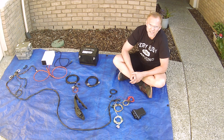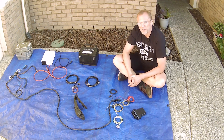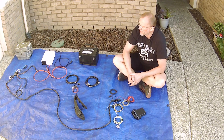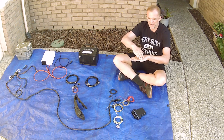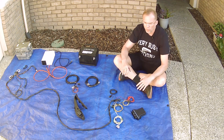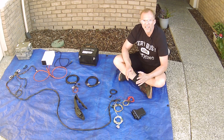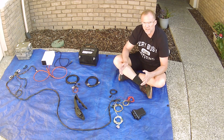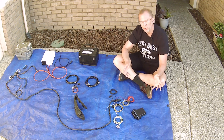Whether you're using a Lexus transmission with an inverter such as this one, or you're using a Nissan Leaf, it still has an inverter. The Nissan Leaf has what I call an integrated inverter — a pancake stack. There's a motor on the bottom, then another stack which is the inverter, and on top of that is the charger. Each manufacturer does something unique, and there are pros and cons to each implementation. The Lexus has what I call a remote inverter, where you use a long cable to connect the inverter to the motor.